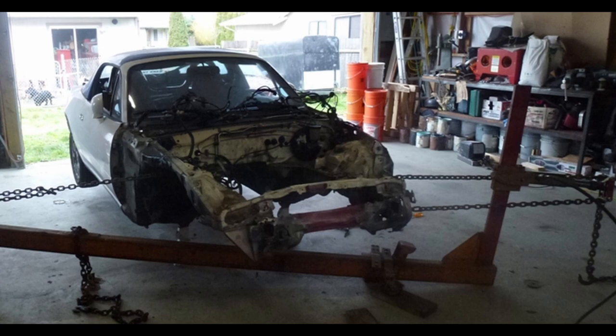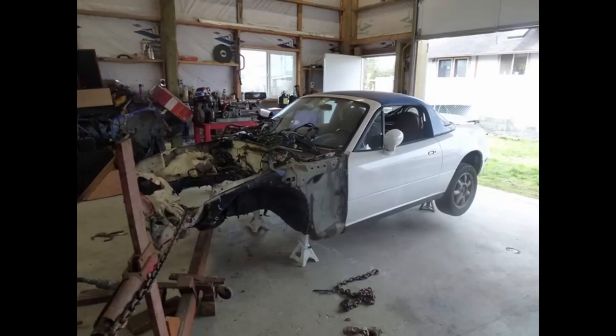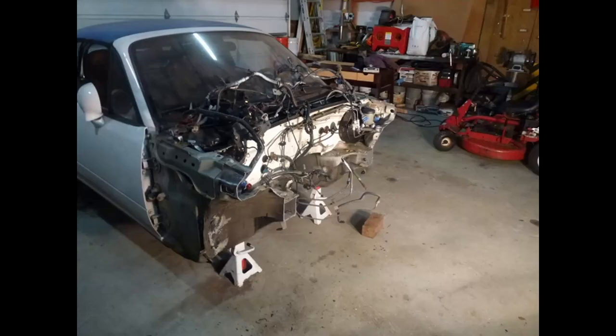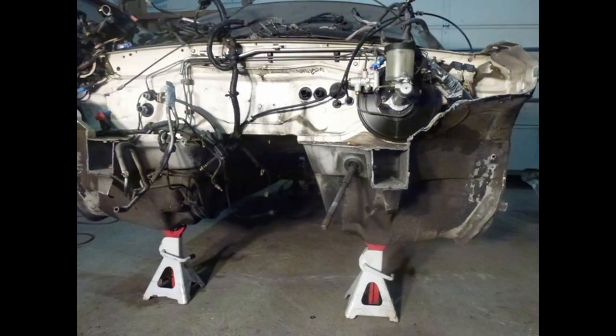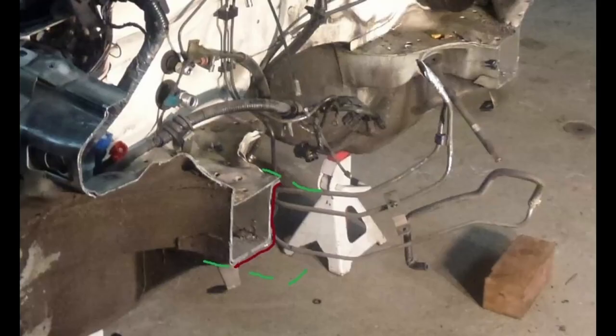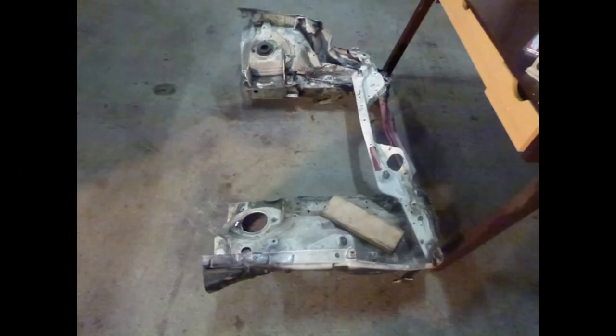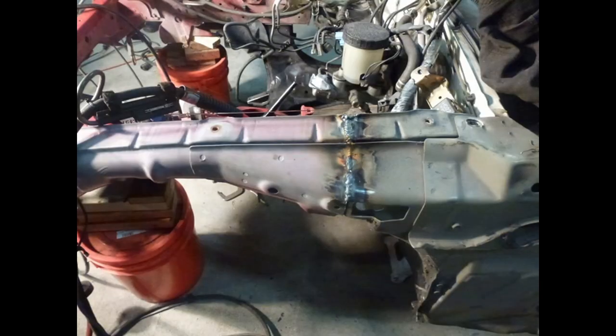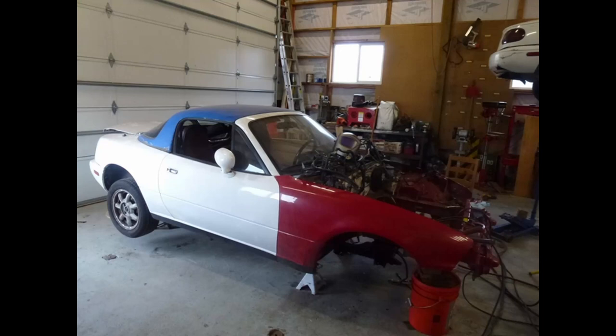Here I tried pulling the frame back straight so that behind the shock mounts it would be straight. You can see the bend in the frame rail right there. Here I've cut the frame rails off behind the shock towers, which gives me a good clean starting point up close to the frame rails. This is where I'm going to put the bracket. Here I've cut the part off of the other car and I'm getting ready to weld it on. I did a combination of TIG welding and MIG welding where it needed it.